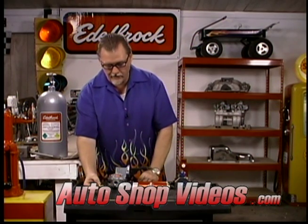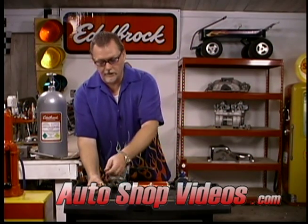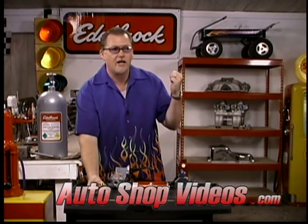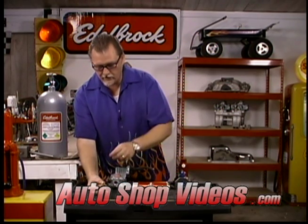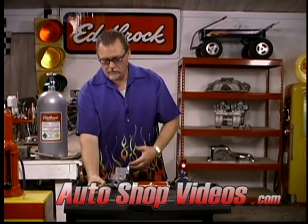Can you imagine having a fitting like this on a fuel pump and you think, hey, I've got a particular size fuel line on here. Well, the pump's trying to flow, and the line from your tank all the way up to the pump might be big, the line going from the pump to your carburetor might be big, but then you get this little teeny restriction in there like that. I mean, that's a little micro hole. This is for like an air pressure line or something like that.